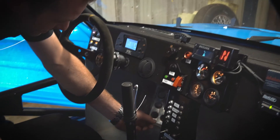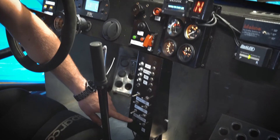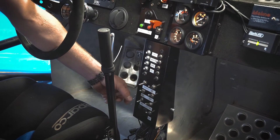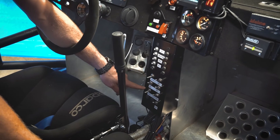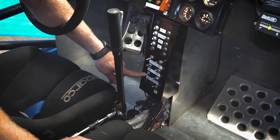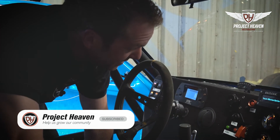Down here we've got a big bank of circuit breakers rather than fuses, so that if something pops out while racing you can quickly push it back in and carry on. And then we've got toggle switches for various things you want to turn on manually: intercooler fans, idle up valve to raise the idle when you're in the pit lane, a switch to turn the dash on and off if it's distracting you, a switch for the shift light, internal vents to keep you cool, power for the V-Box if you want to turn that off, and a switch to turn the throttle blipper off — the one that actuates on downshifts.